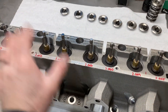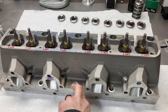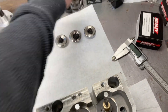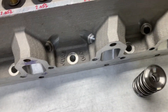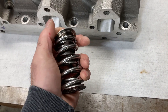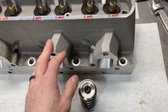Okay, so I began my initial install height measurements and just took a couple of 15-thousandths shims to get everything pretty close, and I know where I'm going to be on my install height. So now I'm going to take a retainer and a valve spring and we're going to put these in the spring tester. I'll go ahead and map out all 16 valve springs and record the coil bind height as well as the seat pressure at 2 inches and 50 thousandths, and the open spring load at .800 lift.